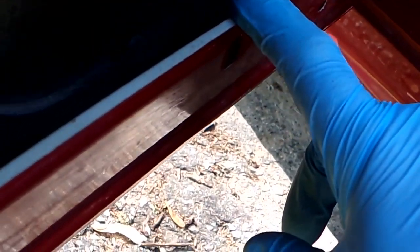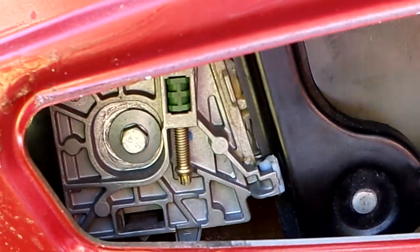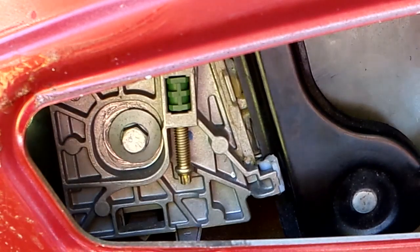I did the same thing on the front. I did adjust the front the tiniest little bit. I did say that usually the problem is there, but I found that moving the front one, which is basically the exact same as the back, you can see the bottom of it here. It's slotted, and it moved in probably about 1 millimeter on the front. And then I'll bring the window down so you can see it. Can you see that? Yep.